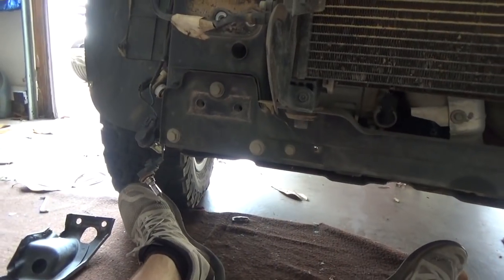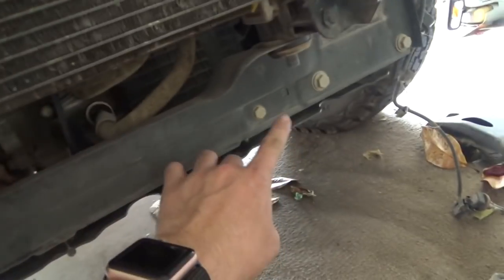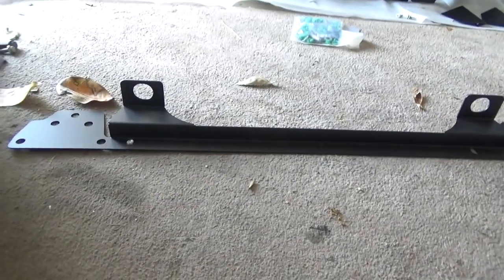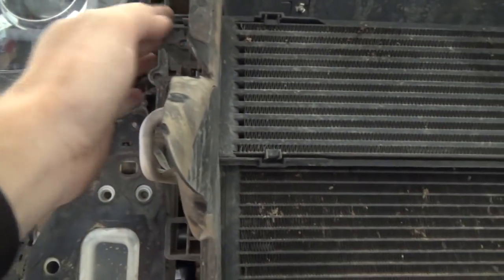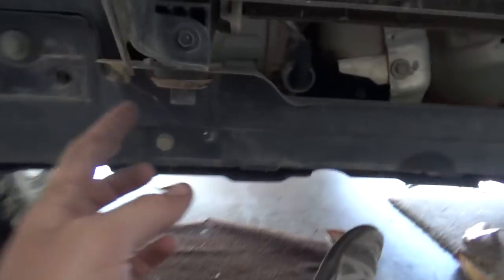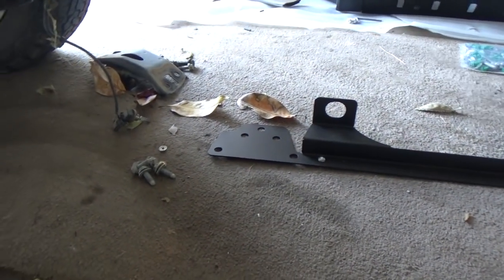Okay, guys. So we got this front skid plate removed. You're going to have, is it four bolts on each side? Yeah, four bolts on each side. So this is a 13 millimeter right here and right here. And these other three, which is identical on the other side, are going to be a 15, okay? So we're going to go ahead and knock those off. Keep all these bolts in place. Have this on hand. This has got supports up here. I'm going to see if this will actually hold steady without showing any signs of loosening. We're good. If not, I'm going to get a jack and a 2x4, put it across here to help support this. And we're going to be taking these rubber pieces out of here and putting them back onto the new one. And hopefully everything will go smoothly.